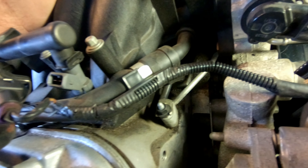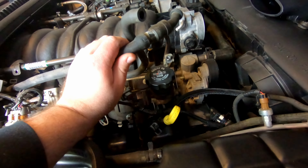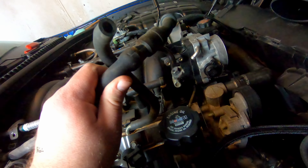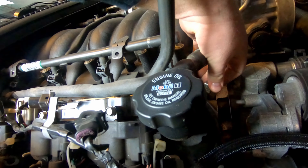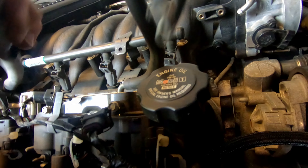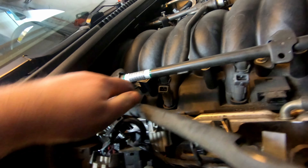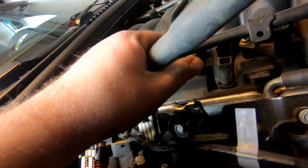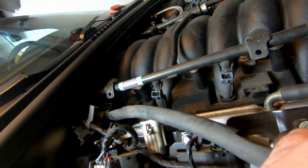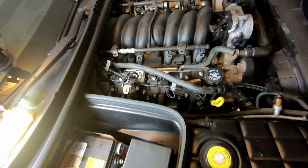So let's go ahead and remove this. What you've seen me do is remove this PCV valve. Down here, it goes over — there's a 10 millimeter nut you have to remove in order to push these out of the way. I moved them over, and if you look down here, it does clamp into the manifold along the top — it's just a hold in place. So you're going to want to gently pry out of those. Don't want any broken parts.